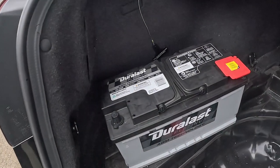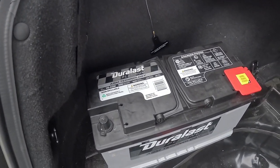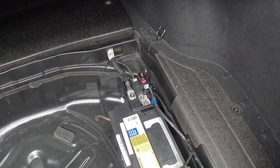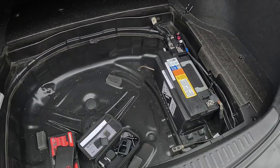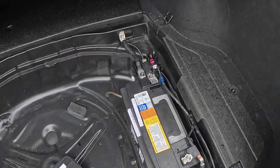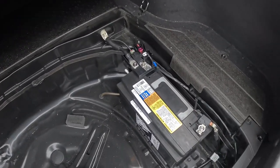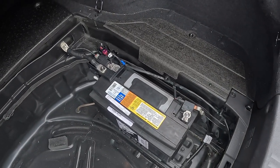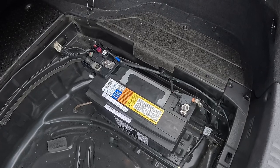This battery is up for change — it's up for renewal at this point. That's why I've gone ahead and I'm here at AutoZone, and I've gotten an H8 AGM battery that I'm going to be swapping out today. I'm going to show you guys step by step how to swap this battery out. It's very simple — you'll need a 10 millimeter socket and ratchet, a 12 millimeter socket and ratchet, and maybe some gloves and a little bit of strength.